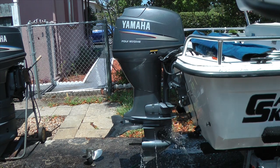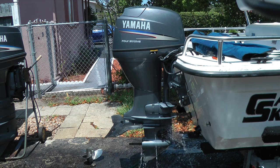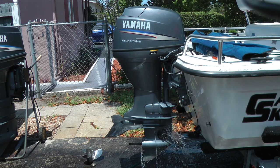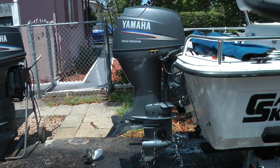Here's the engine — everything is complete. The carburetors are balanced, cleaned, with the new F25LA jets in it. Here I'm going to start up the engine. As you can see, smooth clean idle at 950 RPM.